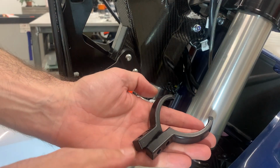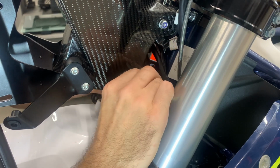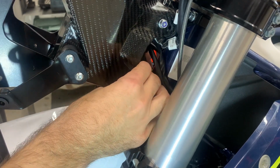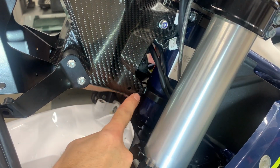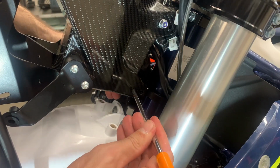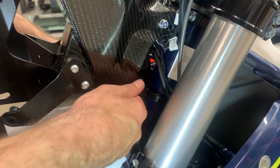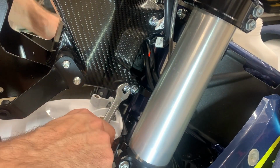Now we take the low clamps, and you need to be a little bit clever. One clamp, you enter it like this from the top, put away all the harness, and then try a little bit to the bottom. Try to place them more or less against the holes. Take some tool and try to align the holes first, and then press the bolt and secure it with the washer and nut. And again, only finger tight. Now enter the remaining bolts and you can fully tighten.